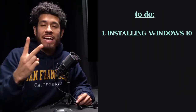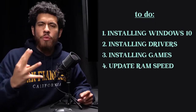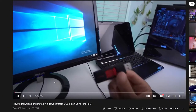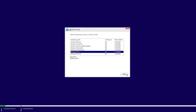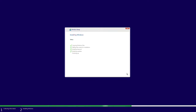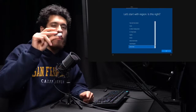We need to cover four things: install Windows 10 from a USB flash drive, install drivers for the GPU and motherboard, install a game, and make sure RAM is running at its rated speed. I made a video on how to create a Windows 10 USB for free — linked in the description — or you can buy one from Best Buy. Plug it in, turn on the PC, select Install Now, Windows 10 Pro, then Custom. With only one SSD it's straightforward where to install. Windows copies all files to the SSD then the computer restarts. After restart, unhook the USB flash drive.